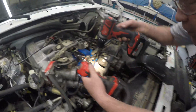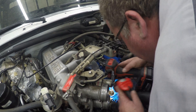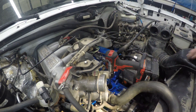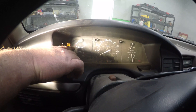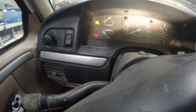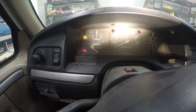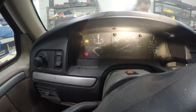What we're going to do is run this drill down in here and get it connected to the oil pump. We're going to come around and watch this gauge right here, and I'm going to go spin that oil pump. When that gauge builds pressure, you're going to signal me. There it goes — it's right in the middle.